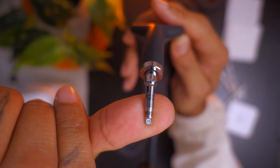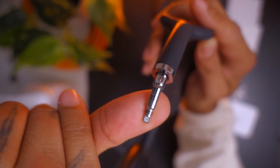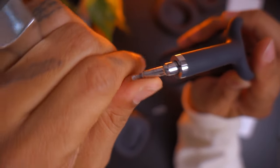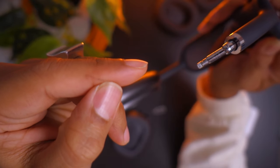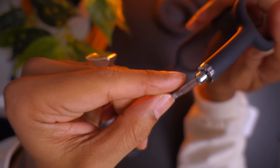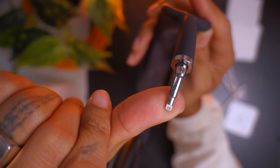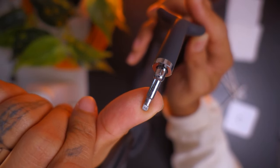You'll see the contact right there. The first time I did this, it was completely black — you can see it's even rubbing off on my finger. That black gunk that came off that connector — if that connector is too blacked and gunked up just from being in your bag and stuff, it'll disconnect.